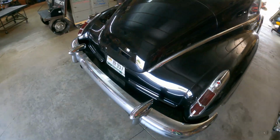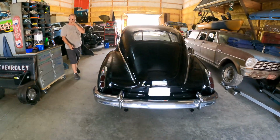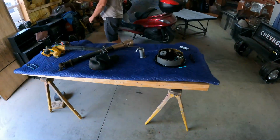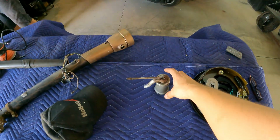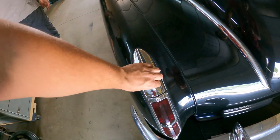So what are we doing? Just a battery swap, some new gas, and firing it up? Squirt some oil on the plugs and cylinders, take the plugs out. Oh, I guess that explains the oil can. I need to get one of these, like a Tin Man. I use syringes. Cool. Need some gas.